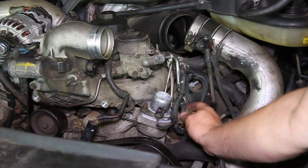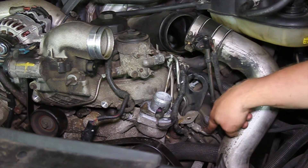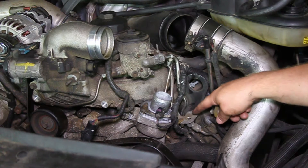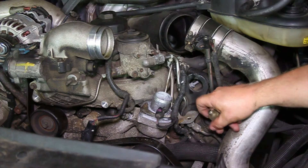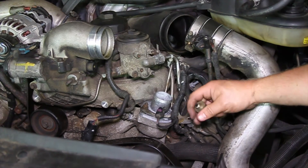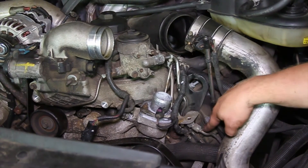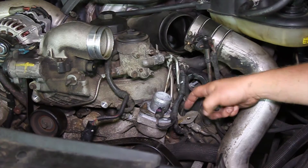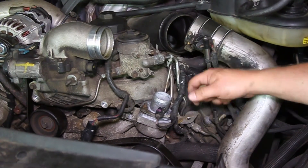Once I get this out of here, we're going to want to take a look at the tube and this fitting. Make sure there is first off no corrosion or any leaks, but also quite often you'll get a lot of carbon buildup in here. Remember, this is tapped right into the exhaust and deadheaded right into the sensor, so quite often carbon will build up and you'll get some leaks. You might want to take a clothes hanger or even a little pick to clean that out and ensure that passageway is good and clear.